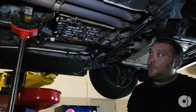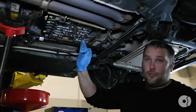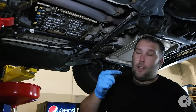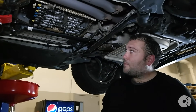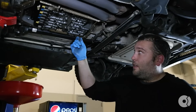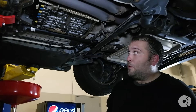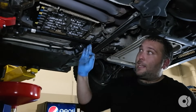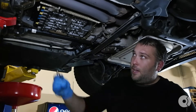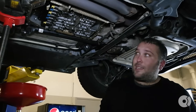Right here, this is your mechatronics unit, which is also the valve body. The reason why it's called mechatronic is because the electronic control element and the hydraulic control element are all in one unit. Unlike a lot of older transmissions where the transmission control unit was in a different part of the car, this is all integrated in one unit. One thing we've heard and seen is some of these bolts that secure the mechatronic unit to the bottom of the transmission might come loose over time — if that happens, you'll have shifting issues and all sorts of other problems. Also, these solenoids are a real common problem as well, but they can be replaced separately.